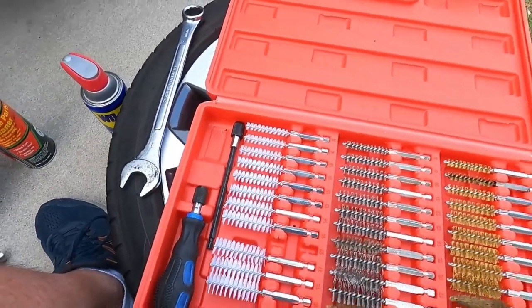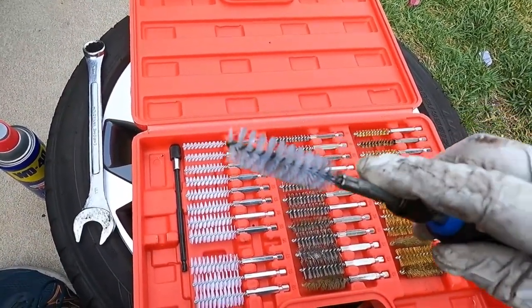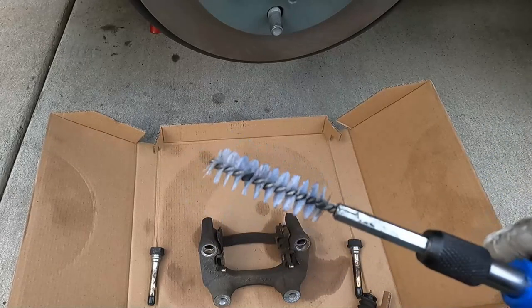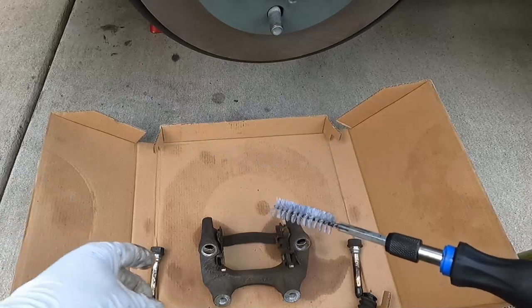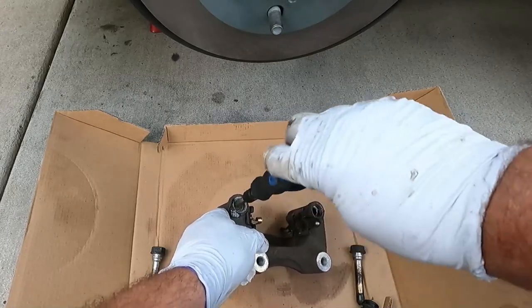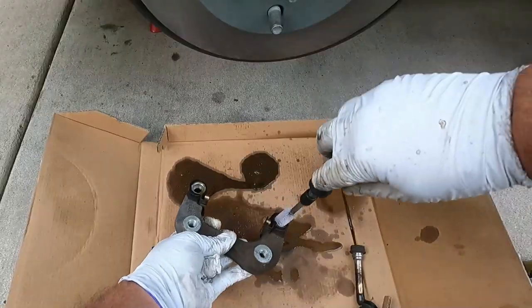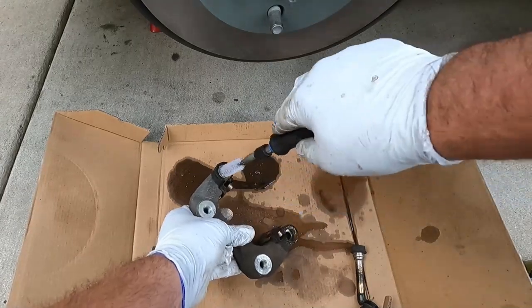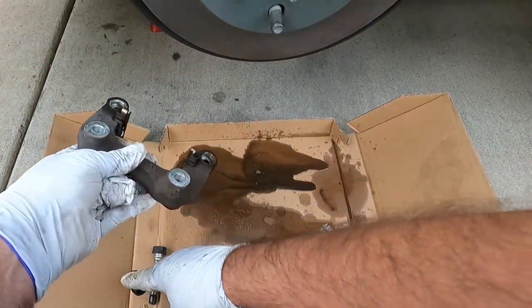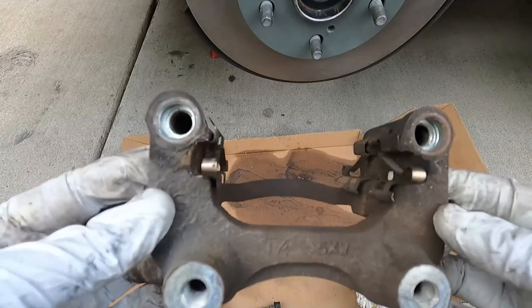Let me show you this brush kit that I'm using. I picked up this brush kit a while back — this is the perfect size for calipers but it comes in lots of different sizes and different materials. I'll get a link to this one in the description. We can just get in there, twist this around, do the same thing on this one, and then we'll just dump that out. Just look at all that debris that we got out of there — these are nice and clean now.